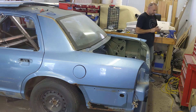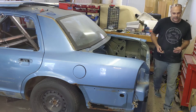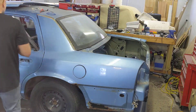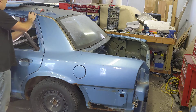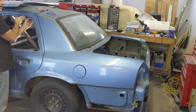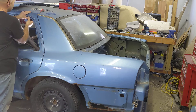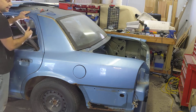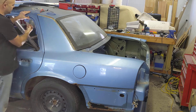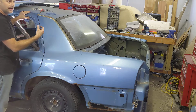This is another reason I like aluminum — it's so easy to work with, easy to drill, lightweight, and it doesn't rust. I'm going to set the bracket on here, making sure it sits between the lines I drew earlier, then go in from the back side and center punch through that hole I just drilled. That's going to give me my first location for the hole in the sheet metal — and that's where my rivet nut goes.